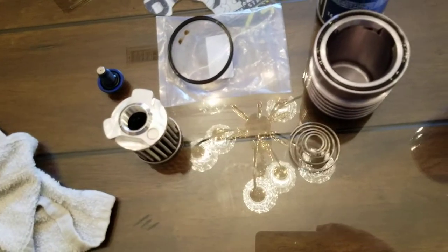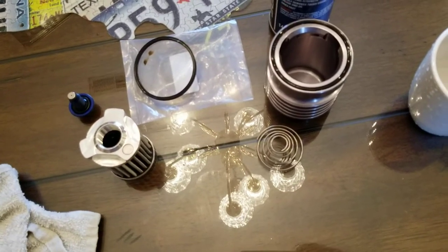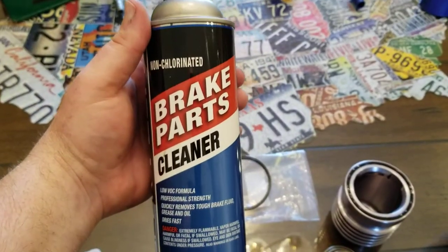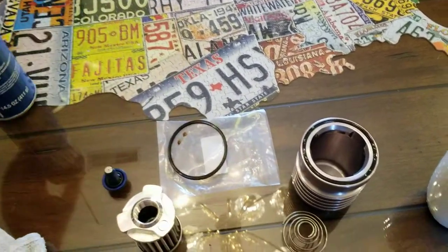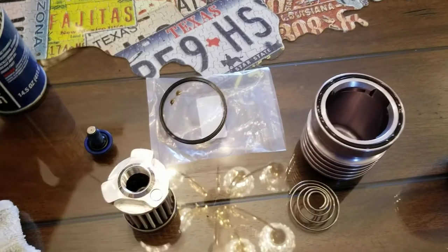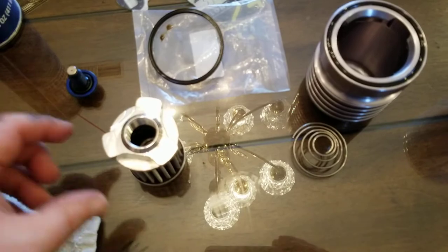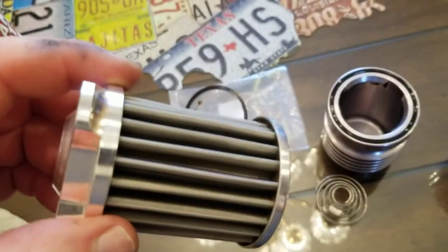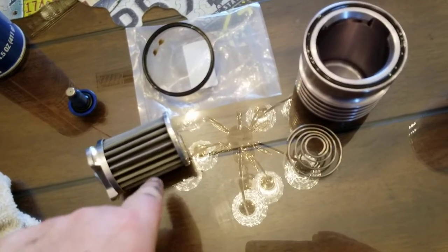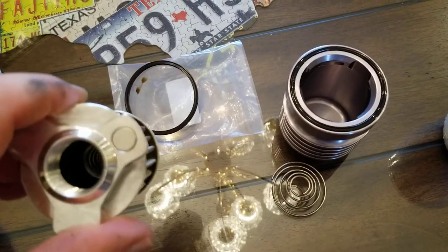What I do first is pull it out and dump all the excess oil out of the filter and housing into my oil pan. Then I take a can of Walmart brake parts cleaner and start on the inside with the little spray nozzle, sticking it in and going around to squirt and blow everything trapped in the little pleats to the outside — from the inside out — because all your particles are going to be trapped going in. Then you just wipe it down really good.